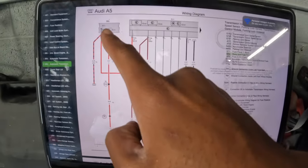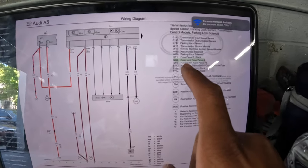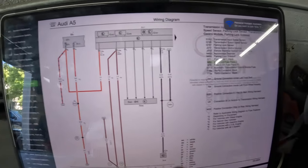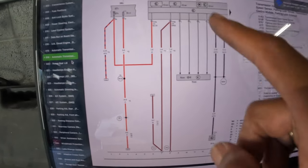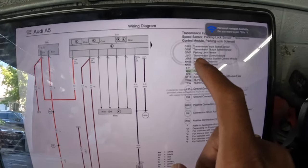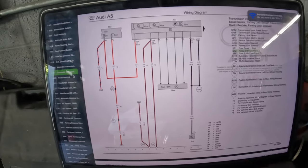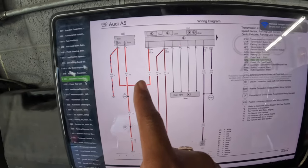For this relay it's SR2, and over here SR2 is the relay and fuse panel — panel 2. ST1 is fuse panel one, black. Basically you have everything needed. What goes to the transmission right here is J217, which is the transmission control module. That's where we need to check to see if everything is good with the transmission.